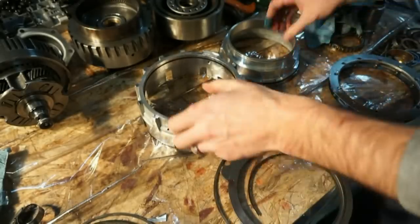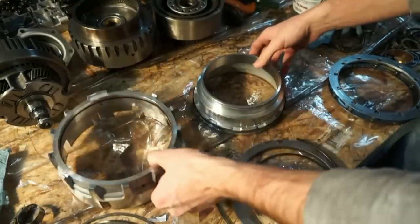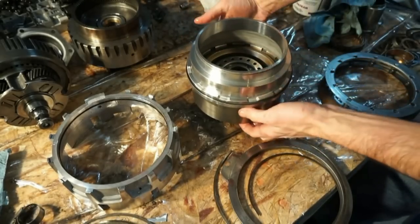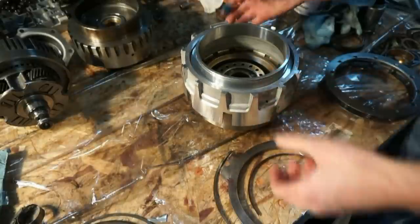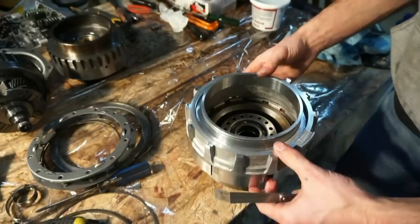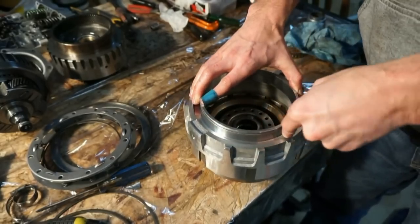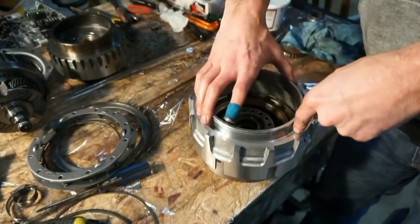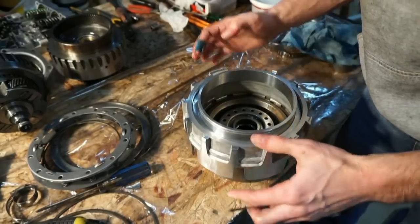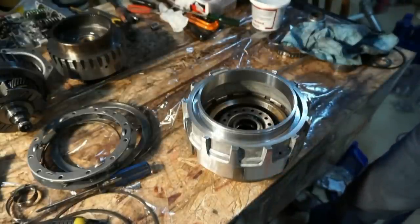Okay, so the assembly of this drum is kind of tricky because you have the lip seals kind of fighting against each other. This one goes over the top this way. Again, there is a special tool to do this, but I'm just gonna balance this up top here, and then I'm gonna put this one over. And again, I'm gonna use the feeler gauge. Just gonna go around the top. You can see, if you can see it from my angle, that none of that lip seal's overhanging. I just kind of go underneath, start working on it from the bottom.